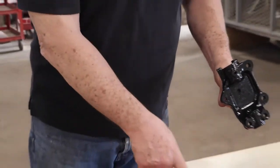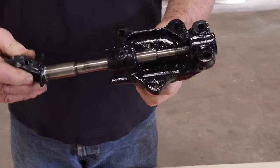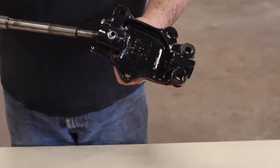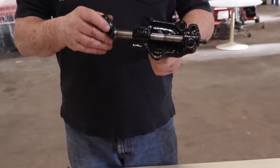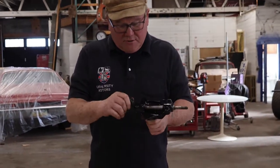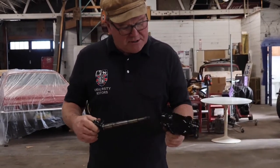Now sometimes the kingpins wear, sometimes the kingpins and the bushings wear. The bushings down inside here, and you end up with the kingpins being able to wiggle inside the stub axle. But very often you can just buy a new set of kingpins, forget the bushings, because to put the bushings in you need reamers and you need mandrels. Sometimes you can just put the new kingpin in, and it's just great. There's no slop or anything, so it's nice.